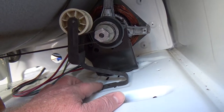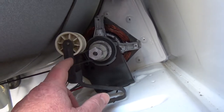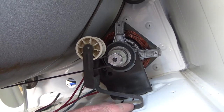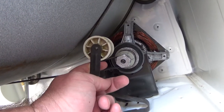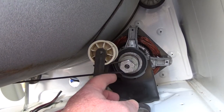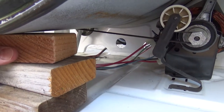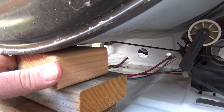When putting this on, put the front clip on first. I concentrate on the pulley first, put the front end in and clip it down, then tuck the belt through and grab it. It's easier with two hands — one hand pushing back on the pulley and the other looping it over. Just don't get your fingers caught in there.